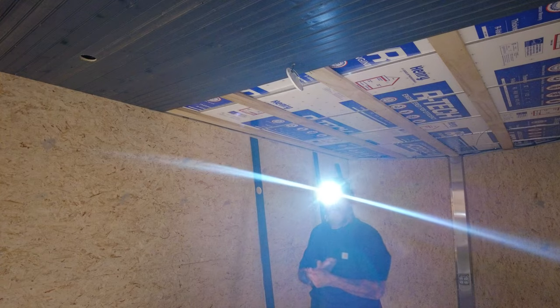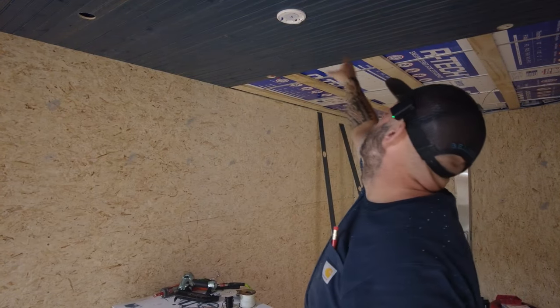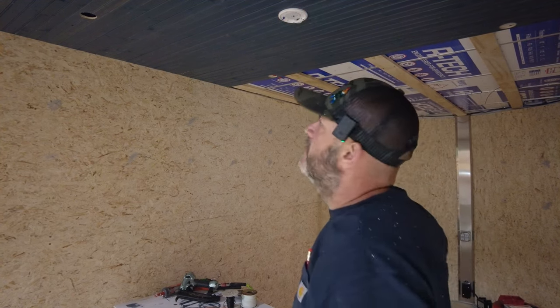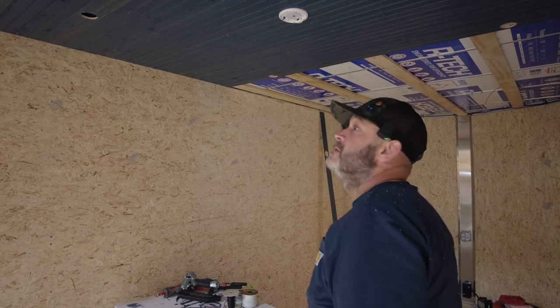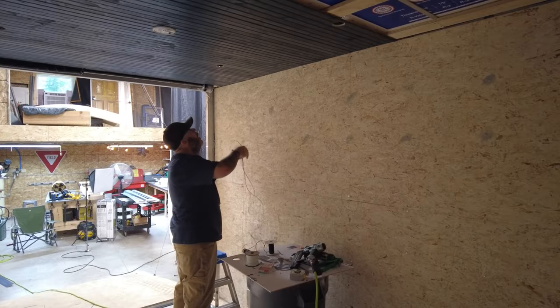I got that light up. I did wind up running a negative wiring, a ground wire, I guess, and grounding it to the trailer frame. That's how it was before, but I put it at a different location. There was no framing there. I got my second row of lights up, and I'm taking a little bit of a gamble that I can fish wires through after, but I think I better get started on it now.